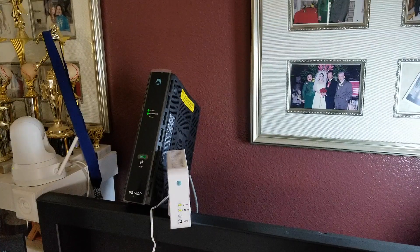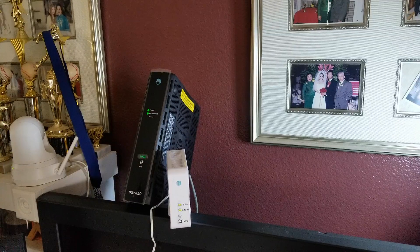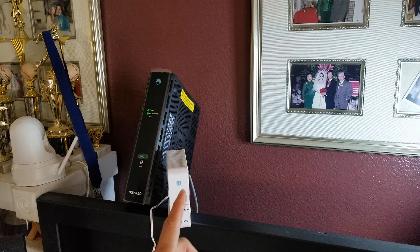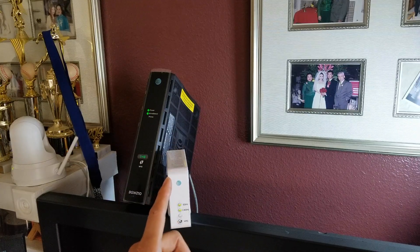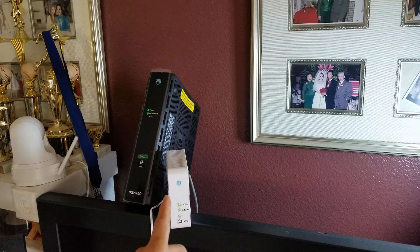You want to make sure your setup is successful. Make sure both the 2.4 GHz and 5 GHz radio bands are enabled. If you need help, use the Smart Home Manager app or go to AT&T.com/enhanced-Wi-Fi. If you have a dual SSID, make sure they have the same name and password. In case you are having trouble pairing your Wi-Fi extender with your router, we're going to use the included Ethernet cable to connect your extender to your router and pair them manually.